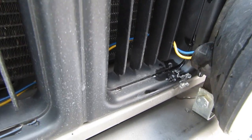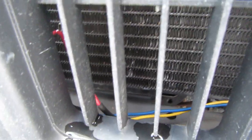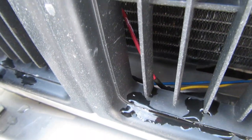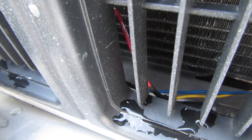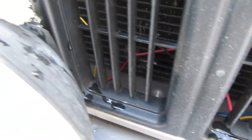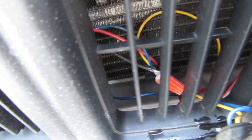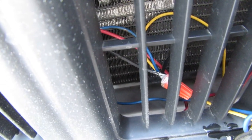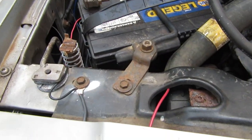Now here's where it starts. Any lights you get are going to have wires coming out of the back that you're going to need to run back. What I like to do is connect them together. You can see right there is my connection — I have it soldered together and then I have the heat shrink insulation on top of it. That's the correct way to do it. If you don't solder and then use the heat shrink, you're leaving your joints open to corrosion and getting disconnected as they move. You want to make sure that you're keeping any wires away from stuff like fans. What I like to do is run one wire and connect them both together. That right there is a wire nut that I have packed with silicone — I find that's a pretty good way to connect stuff together. After that, you want to take what was two lights running into one wire and run it up into your engine bay.